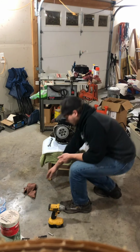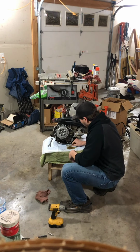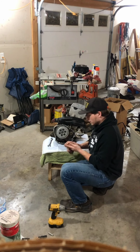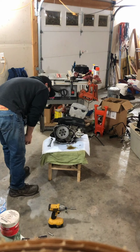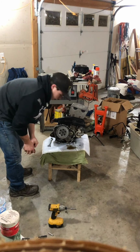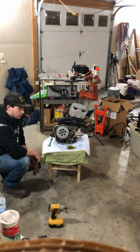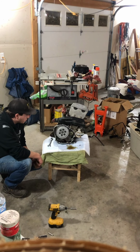So it looks like the only mess was the oil from the oil filter. And then I also need new crush washers for both of my bottom fittings for my oil line, because it looked like they were both leaking. So the top one is still dry because I did have it running, was breaking it in a little bit for the new top end, but the bottom two are leaking, so I'm gonna get new crush washers for those.